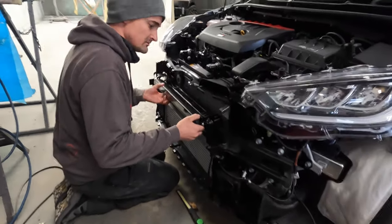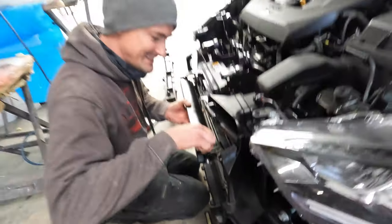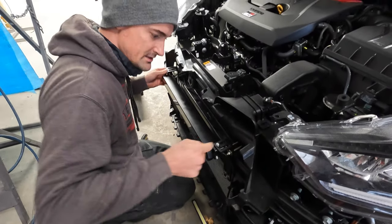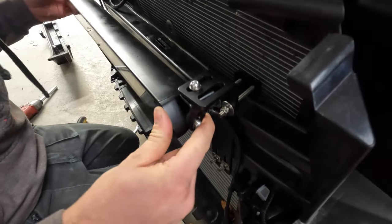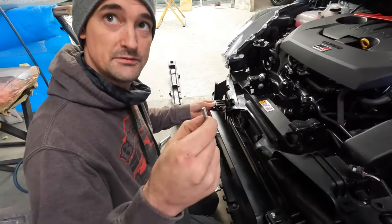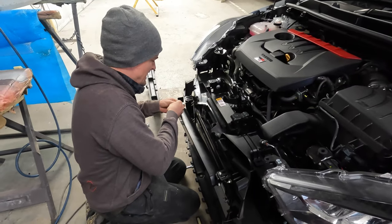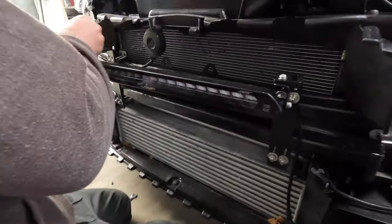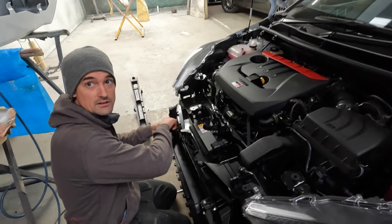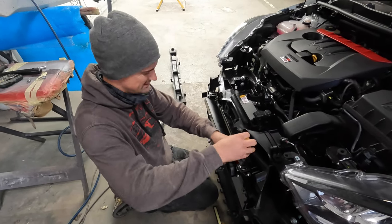Now getting the light on. Tommy's already fitting the brackets — he had to cut a few of the bolts down, as the YouTube video suggested. Otherwise they don't clear — if you go all the way back, they hit on there. They were another length, so it's one of those one-size-fits-all, one-size-fits-nothing kits. A little bit of adjustment needed. It's aftermarket, though, isn't it? They are good, the laser ones. It's just they've made a kit to fit every single car, so you've got to adjust them a bit. That's why you bring it somewhere like this, so we can do it all properly.